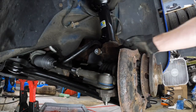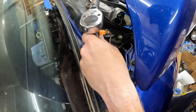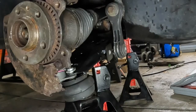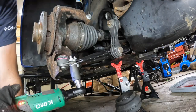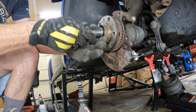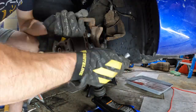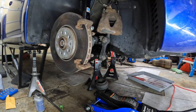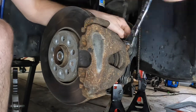After that I move over to the pinch bolt that holds the strut in place — tightening that up and torquing it down. Then I move back up to the engine bay to tighten up the strut top nut and torque it down to its specification. Moving back down to the wheel well, it's time to get the sway bar end link in place — go ahead and replace that bolt and torque it down to spec. Now I'm coming back to the ball joint bolts and tightening those up evenly and torquing them down. Finally I'm replacing and installing the new axle nut, then replacing the rotor — cleaning it up since I've been touching it a bunch during this project. Then I'm installing the caliper carrier and after that the caliper, torquing both of these units down to the right specifications. The carrier torque spec is a pretty hefty one.